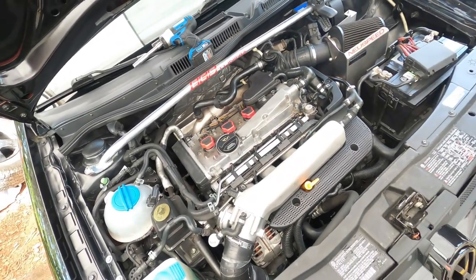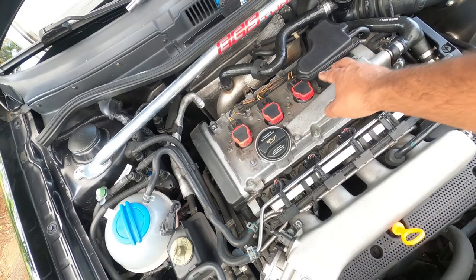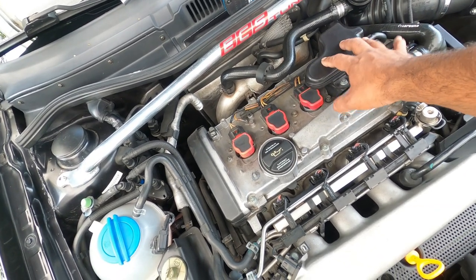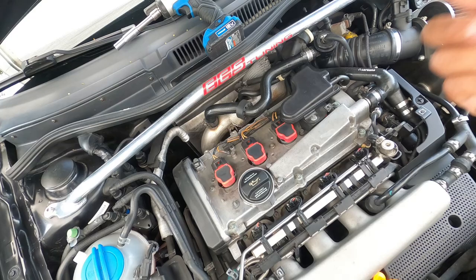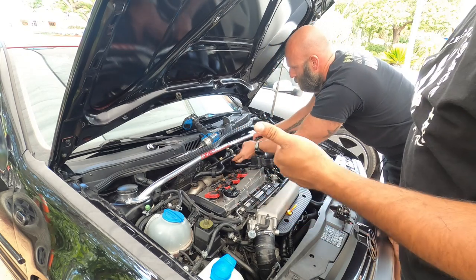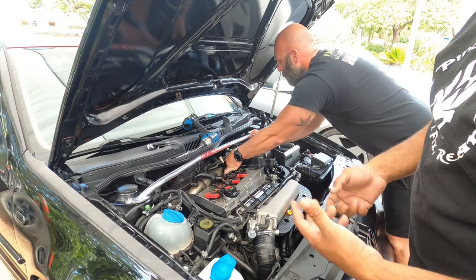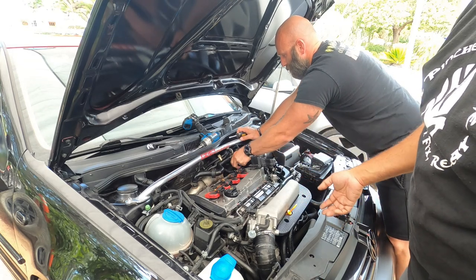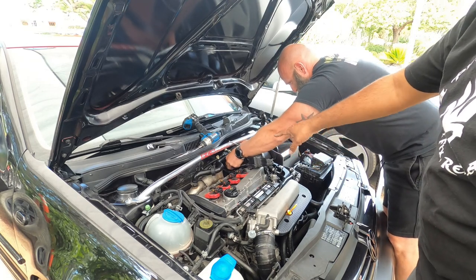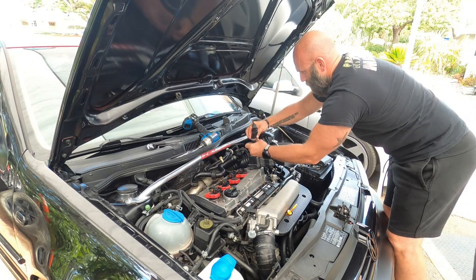Your first step is to take off your vacuum reservoir if you have it, then remove all your ignition coil packs - just the wiring. There's a 10mm bolt here, a 10mm here, and then there's allen bolts right underneath that hold this whole place together. The big reason why we're doing this is two reasons: number one is misfires, and number two is old plastic that gets brittle, cracks, and causes premature shorts which makes your car misfire and not run correctly. Rob is removing the hockey puck or the PCV hose that's on top of the valve cover - it's in the way of the harness.